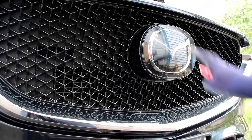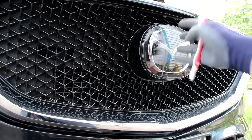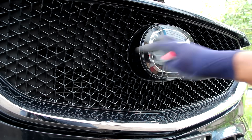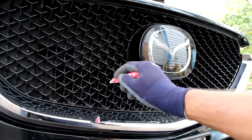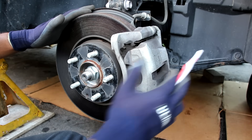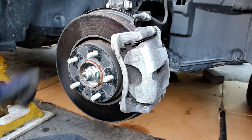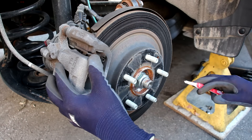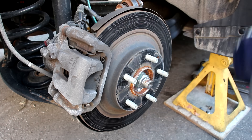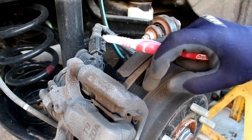The radar sensor for your distance measurement is actually behind the emblem. I personally never liked this style of emblem because it just looked like a flat sticker, but when you realize the radar sensor is buried under here it's actually a smarter idea than putting it further down on the bumper like some other automakers do. Besides, most of this grille isn't really used for airflow anyway — the air holes are just on the bottom part and all the top part here is just a solid piece of plastic. Taking a look at the front brakes on the CX-5, this is just a single piston floating caliper design with a disc. The rear brake setup consists of a single caliper on a solid disc rotor, and with only 37,000 kilometers I'm actually quite surprised this rotor is pretty scored up and might need to be replaced soon. Because this is a modern vehicle it does use an electric parking brake — this actuator is going to squeeze the pad together against the rotor to stop this wheel.